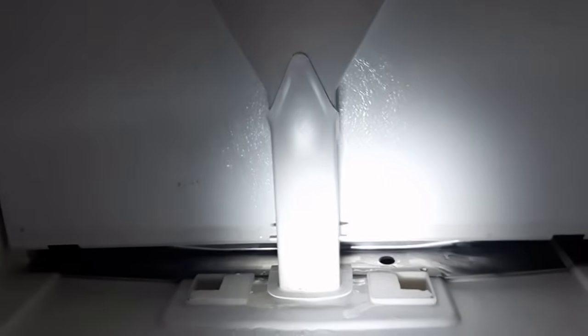As it turns out, I didn't need to remove the back panel, so I didn't need to remove those 2 screws, and I didn't need to remove the ice cube tray holder either. When I did this the last time, the ice jam was so bad, probably because a bunch of corn and stuff had gotten spilled back there and frozen in there, that the ice actually came up pretty close to the coils. This time, not so bad. So really, it would only have been 2 screws.